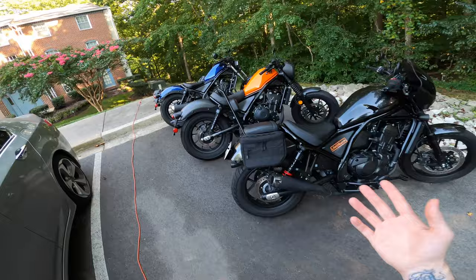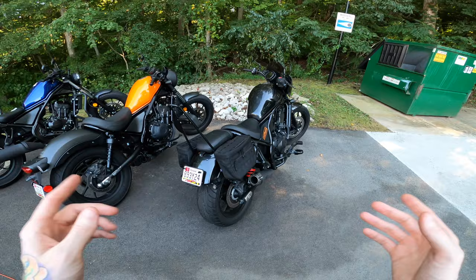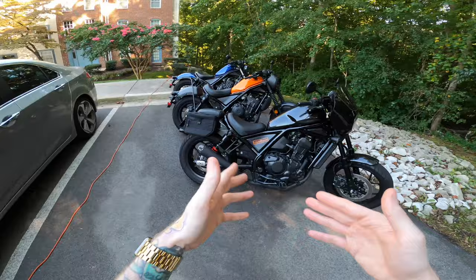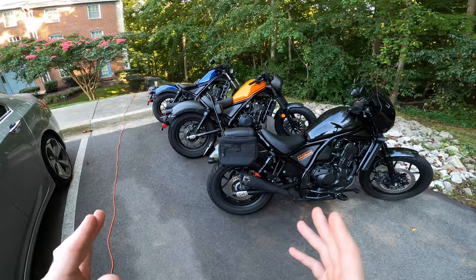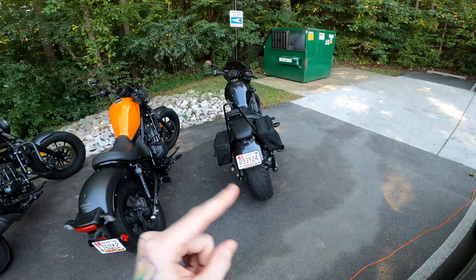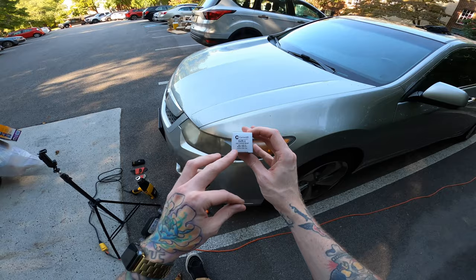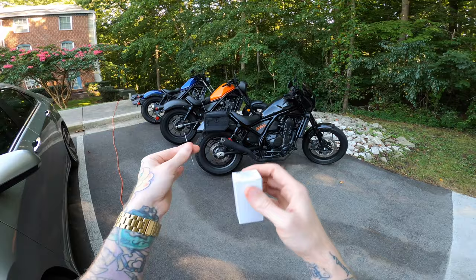So I sent that link over to Burley Brand, they got one of the diodes, tested it out, and they were like, 'Hondas are so freaking weird, but yes — that worked.' So since then, all of their kits have included this diode, and it's in the instructions on how to install it. Any customers who already bought the kit without the diode were automatically sent one. That was months ago, but I barely use cruise control so I haven't cared — until now, because I'm about to go on a five-day trip. Oh yeah, and the bike also has hyperflash with these turn signals because the draw is different, so the kit now includes load resistors. Instead of those, I got a flasher relay from Custom LED that just plugs straight in with no wiring, so we're going to install that too while we're under the seat.